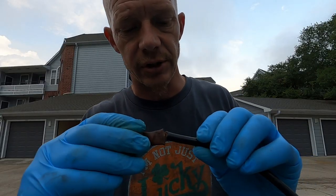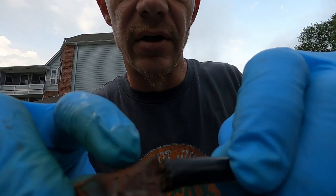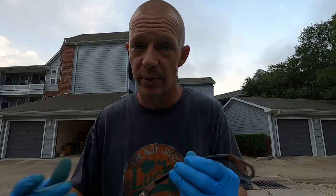I got y'all set up on the hood of the truck. Check this out — see how half of that cable's broke? Plus you can see how it looks real old and corroded. So we're going to get two ends, make one real quick, put it back on, and solve the problem. It shouldn't cost more than 20 bucks to fix, if even that. It'll save you from buying a starter, and it's something to check besides just assuming you need a starter, battery, or alternator. Check your wires — this is one of the cheapest fixes you can do.